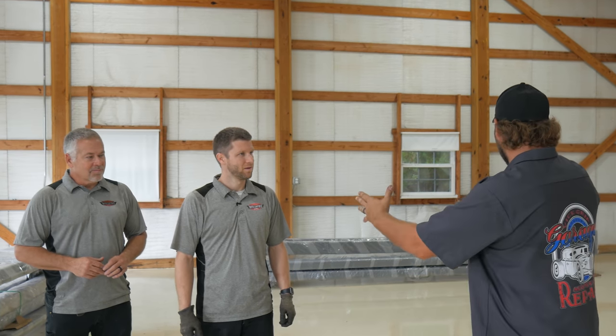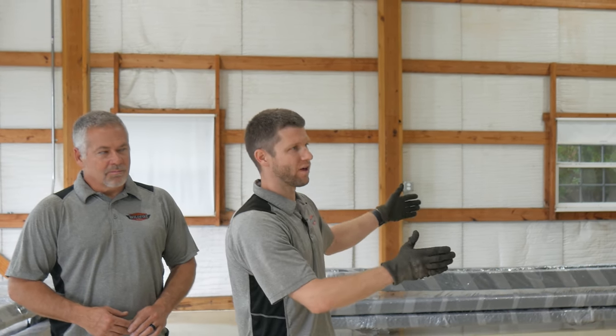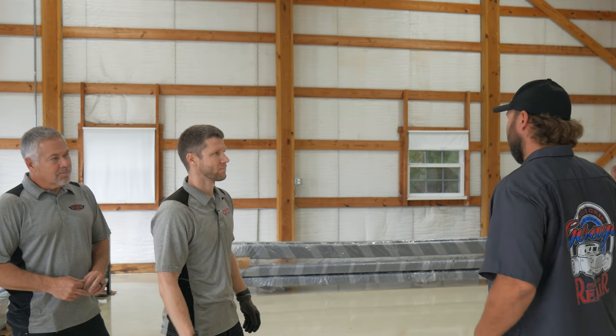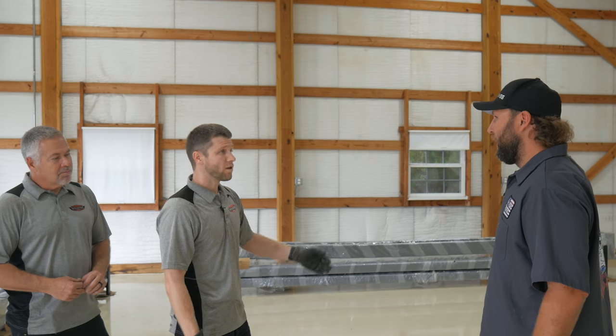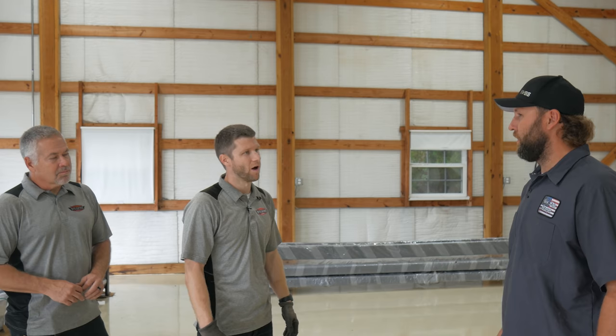Can you tell us a little bit more about this beast? Yeah, absolutely. You have a great garage, great space, but we tend to have too many cars, too many toys, and it fills these spaces up before you know it. The double wide — what's really neat from a storage standpoint — you put two up, two down, in a smaller, more compact space than two single wide lifts. And an added benefit is we don't have those posts down the center, which makes it a more open drive-through area. I could put a boat, motorcycles, whatever below. It's got six foot nine inches of clearance at the top — trucks, boats, motorcycles, all of it.